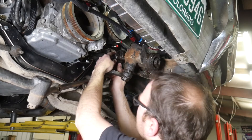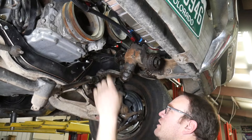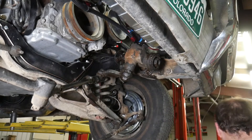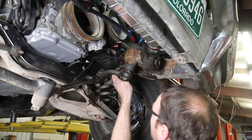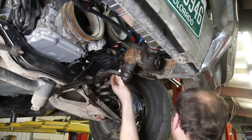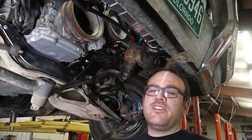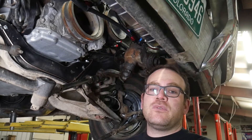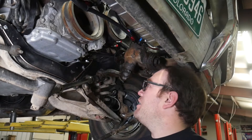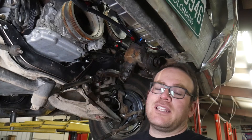To undo the steering shaft, there's a 12-point headed bolt right here. It looks like a half inch, but it is actually 7/16. If you don't have a 12-point socket, you can always undo it at the rag joint. Or if you have a box-end wrench — probably not a ratcheting wrench on this one — you can use the box end to take that bolt loose.